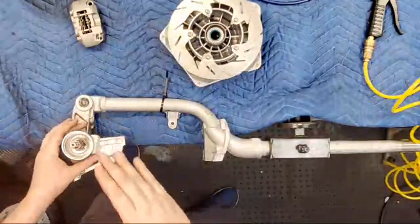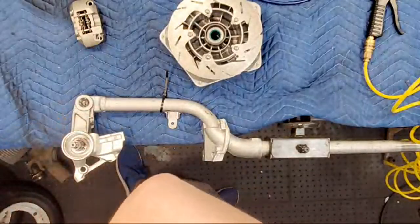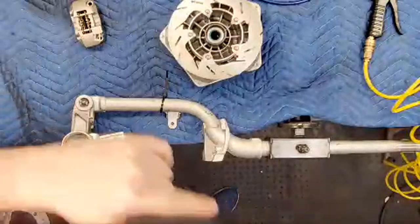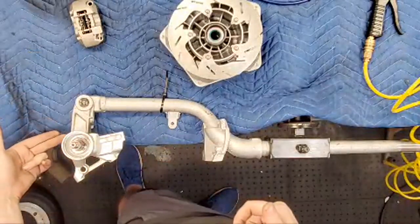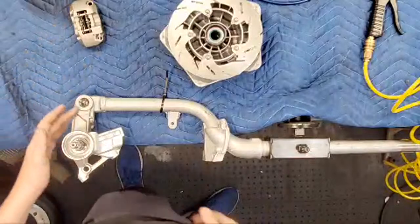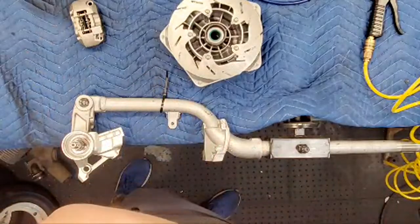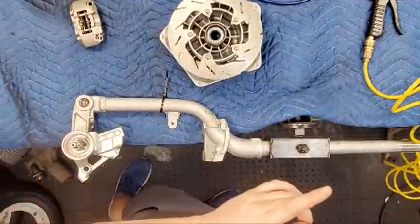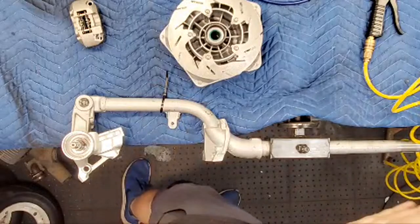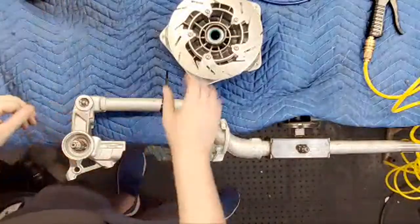Oh, yeah, significantly. Yeah, that's what I did. I think you commented on the pictures of the fork with the green bike that I did just recently. We had to end up moving the shims on both of these sides underneath the mounting to get it well centered. But I think he's saying it's still not balanced. So when he's coming in, the guy rides hard. He goes to the Dragon and just rides the crap out of it. So when he comes in, we'll check the wear and see if maybe we have to move the shims left or right. Well, these we can mount later. All right.